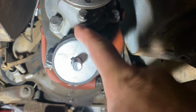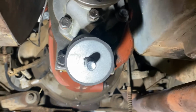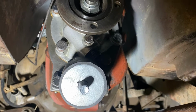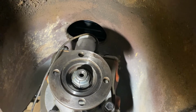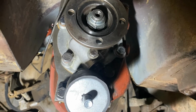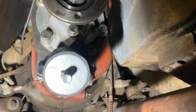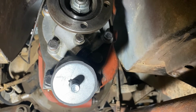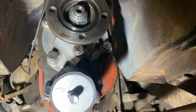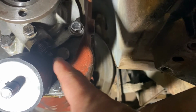I've got to take off this mount, which I cleverly put back on earlier, and that's what caused me to drop this transmission on its top and break the top that I had. Everything's still okay inside. The top just broke off. The shifter connection there broke off, and I had to go get an old transmission that had a top, so I could replace that.